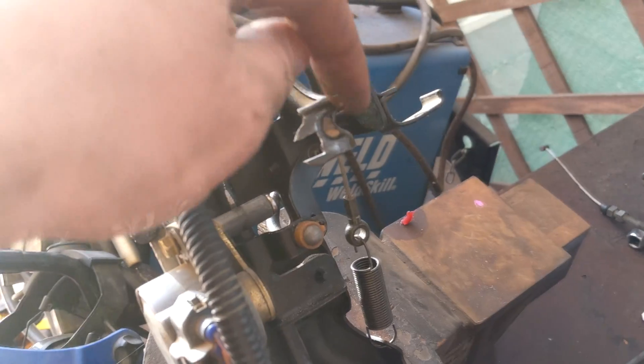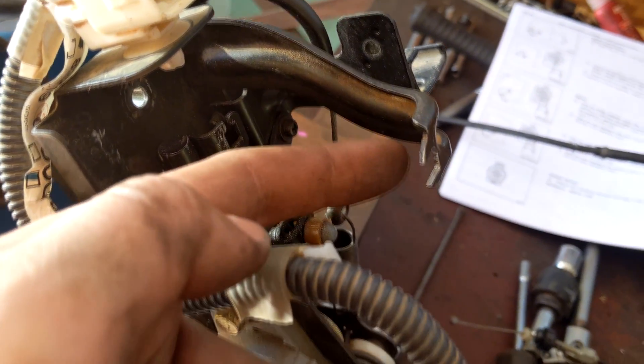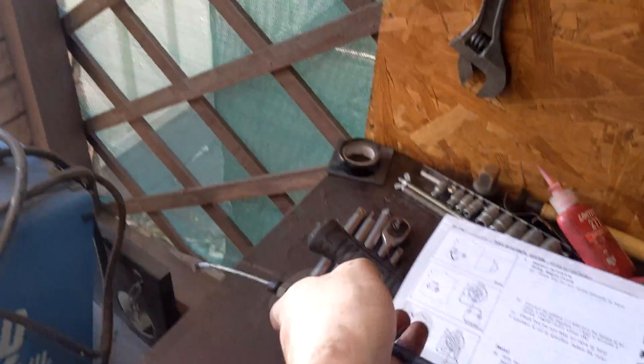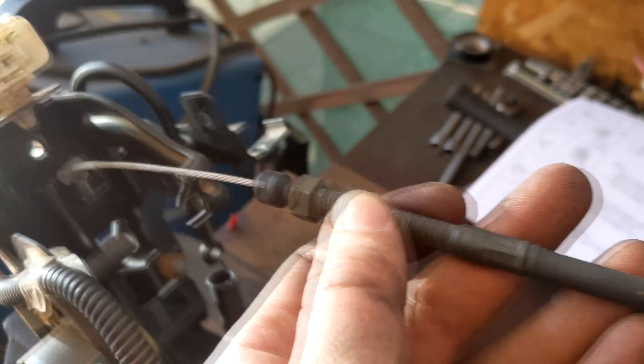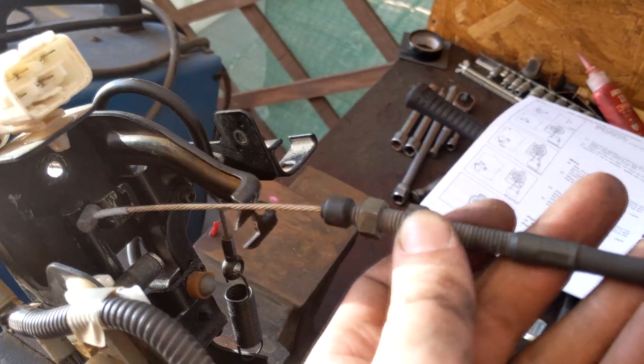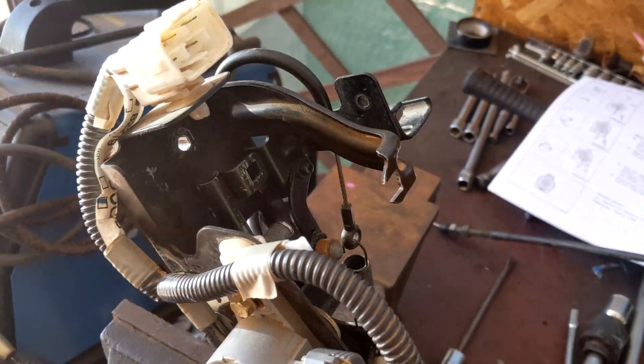It turns out I'm going to have to extend this about 30mm or so, because when I'm at full throttle, this arm actually touches here. So when I have this piece in it - which is say 10mm long - it actually hinders full pedal travel. Not that I go at full throttle anyway, but I'm going to have to extend this out somewhat, which will be a bit better because I'll get more adjustment. The further I have it back, I won't have to chop the cable, but I'm going to have limited room behind the dash, so I've got to keep that in mind as well.